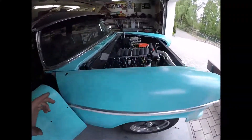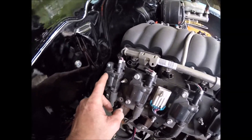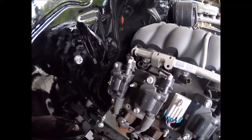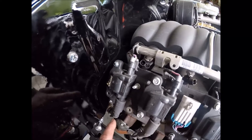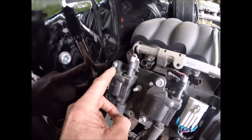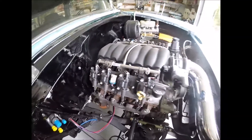What I knocked out here - it looks simple but it looks stock. Since this is so close right here, I did my little dimpling, painted it, and I just had to basically take this coil pack and move it in about half an inch, five-eighths of an inch, and basically clear right here. That's my 10 millimeter. Here's what they usually look like. It's the little small stuff like that that takes up the time, but fabrication is fun.